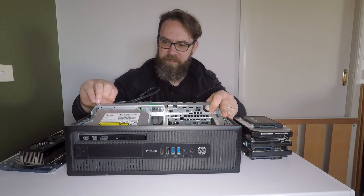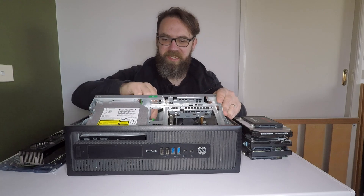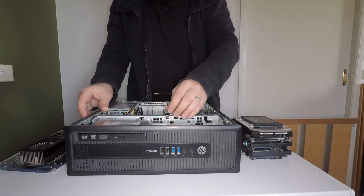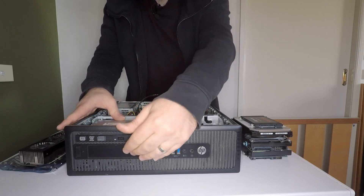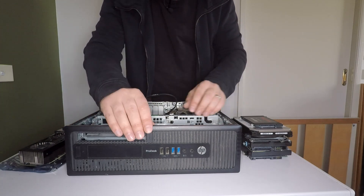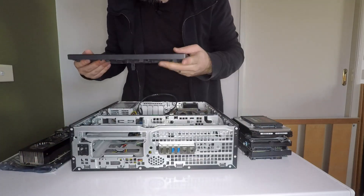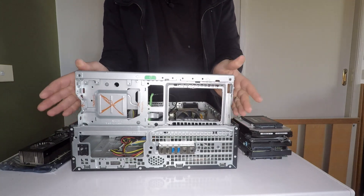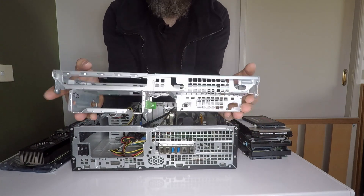The first thing I'm going to do is remove the optical drive — I'm not going to be using it because it's taking up a SATA port. It's pretty simple to remove; they have these nice little green tabs everywhere that give you an idea of what needs to be done. Pushing in that tab will allow it to slot straight out. There are also little tabs at the front of the case — lifting those up will allow us to take the front of the case off. This part isn't really designed to come out, but you can just bend it around the case a little bit, and here's our drive tray.